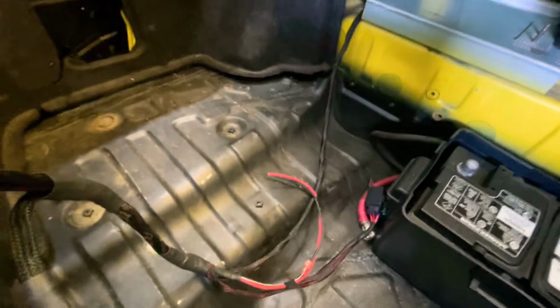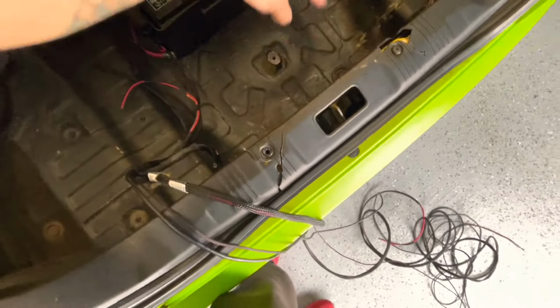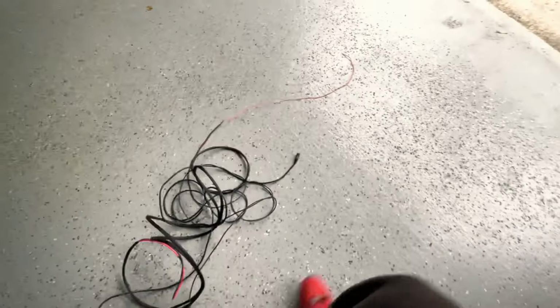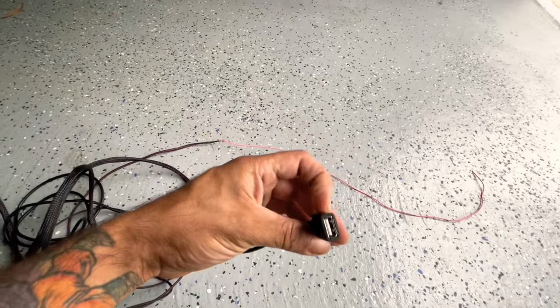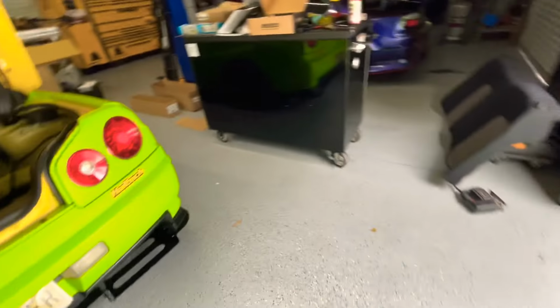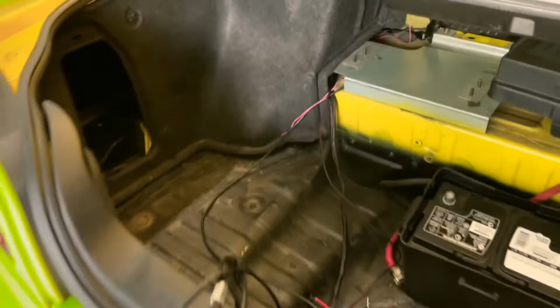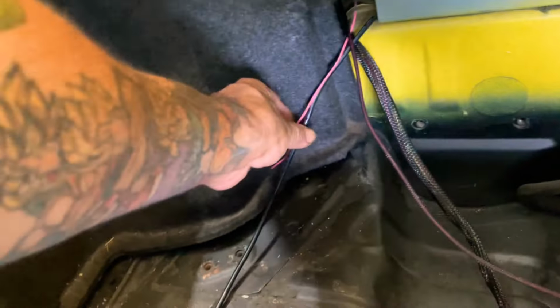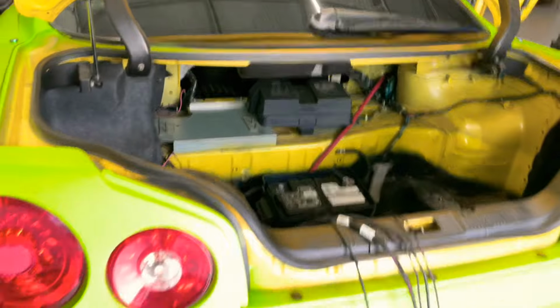So that will be one compressor. And then the wiring, I'm just gonna wrap it around there, because the only thing that I need to go up is the controller here for the little controller up front. So I'm gonna run that too and get to it. So stay tuned, guys. All right, I lied about the one wire going through. So we also want to use that pink wire, which is the ignition wire that, when you turn on the key on the car, turns the system on.